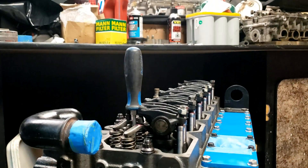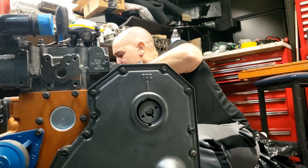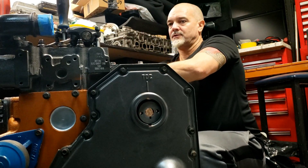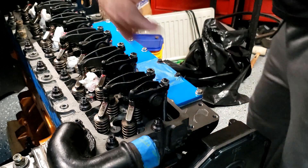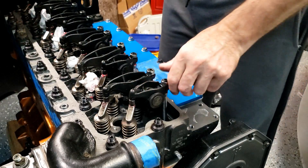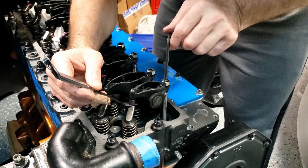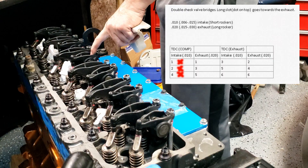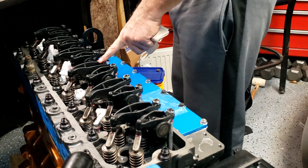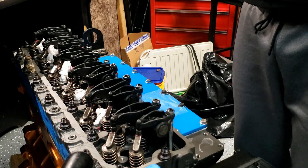This should be at its uppermost point because it's riding on top of the piston. I'll use some bolts on the crankshaft and spin it with a crowbar. That was top dead center. Cylinder one intake — I'll snug that down and tighten until it's clamped down a little bit on the feeler gauge. I've got intakes one, two, and four at 10 thousandths. Exhausts one, three, and five — the long ones — at 20 thousandths.